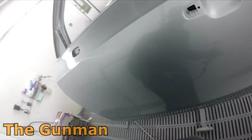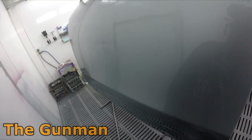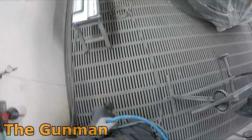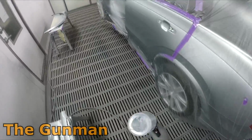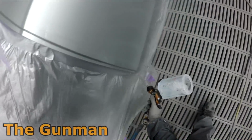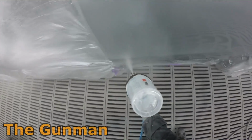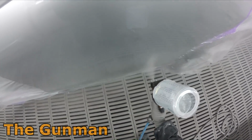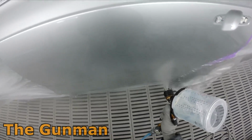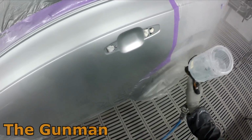When I used to work in a prestige workshop back in Melbourne, we were using the Glasurit 255 clear, which was a proper HS clear, and you could get those European style finishes with ease straight out of the HVLP I was using. I think it was the H3, back in the days when I was using the GTI Pros, and the bosses made me use the HVLPs because the paint company sold them the idea that you'll save more paint using the HVLP.